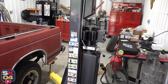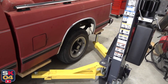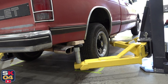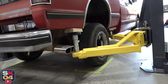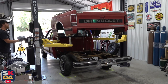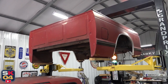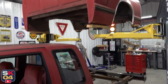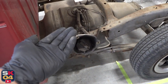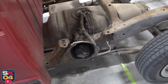All right, let's try to pick up this bed. I'm going to be using the lift. I have the arms positioned at each corner as level as possible with two-by-fours to help evenly distribute the weight. Well, that worked out quite nice. One thing I want to point out — the bed started to catch the fuel filler neck as it was coming past it, so I had to reach in and just tuck it off to the side. Just something to be aware of if you're going to be doing something similar.